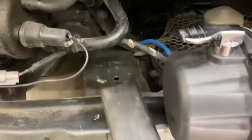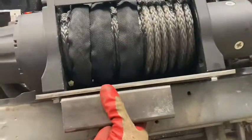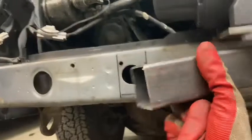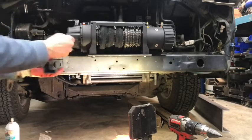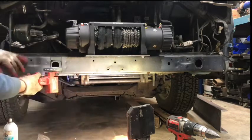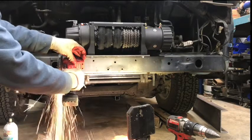I'm going to come across the front of the frame like this and out through the frame rails using three-sixteenths tubing — this two-by-two here — and slide it into the frame on each side and use two or three bolts to hold it in, with just one piece coming across the front to tie them together. I think that's the simplest and strongest way. But the frame inside I think is two and a quarter, so I'm going to mark and cut it and see what the actual inside size is, because if it's two-by-two, it'll be loose. I'll also do a quick visual inspection now that I have it open — there's a little bit of dirt but no rust at all for a 30-year-old van.